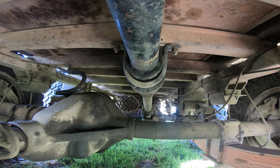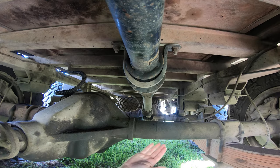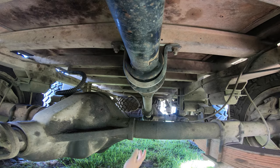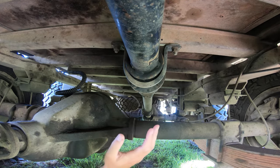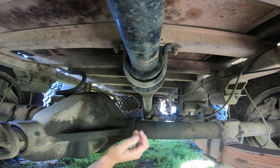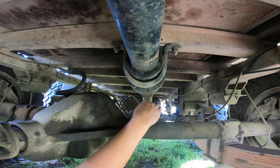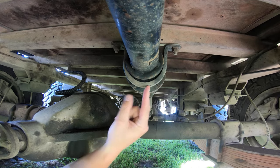We are currently underneath. This is a six-wheel drive and yes, all six wheels drive — the third axle is not a lazy axle. These Land Rovers were originally set up for a power trailer. They're a four-by-four modified into a six-wheel drive, and they use this shaft here as the power trailer — it's a PTO drive. Down here is our second axle, and over the back is our third. They have this big Cardan joint up here.